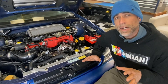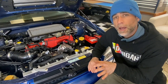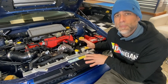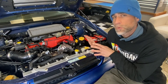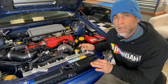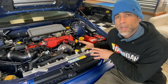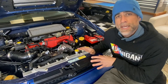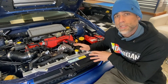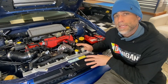So there you have it guys — this engine actually runs pretty well. It fires up, idles really well at cold idle, and idles well at warm idle speed around 800 RPM. It's really misleading because you'd think this engine was running just fine, but there's that one intermittent check engine light for the cylinder number four misfire. The next step is diagnosing this issue. If you have no compression in one of your cylinders, how would you approach this problem?